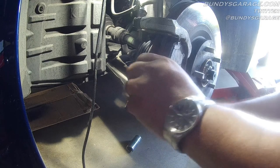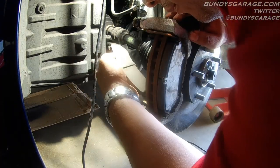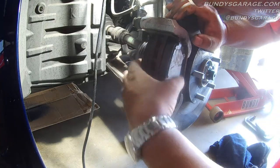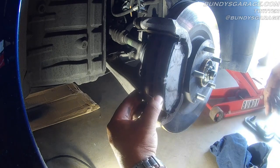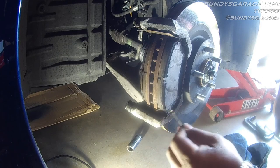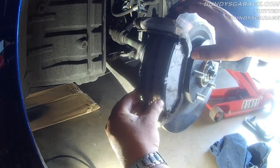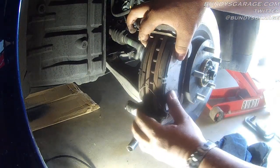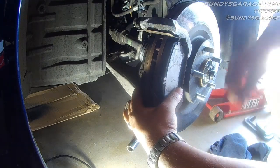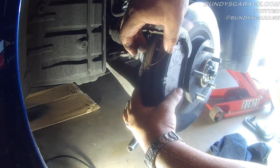Let's get our brake pads ready. Bring in the brake pad — inside. There's one, the outer one. Bring in the inner one. Now we've got to bring in these brake pad pins back into place. When they're faced up there's a hole here and a hole here, same on top. I like that design — it's a pretty cool design. It keeps the brake pads from squealing and keeps them pushed out correctly. It might get hard to put the brake caliper back in, but hey, it's a neat design. There's the bottom, working on the top — there's the top.